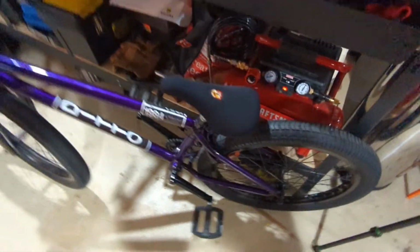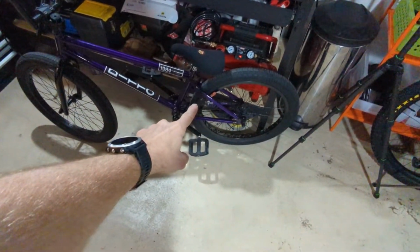They're specifically designed, my guess is, for V-brakes, right? And V-brakes are the long-armed brakes that come together in the center. They're not the ones that crisscross like on this bike, which are called U-brakes. So there's a difference between a U-brake and a V-brake. V-brakes do tend to have a lot more leverage, and thus I think these pads on a set of V-brakes would work really, really well because you have more leverage.